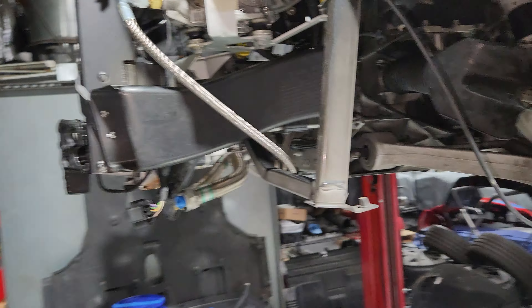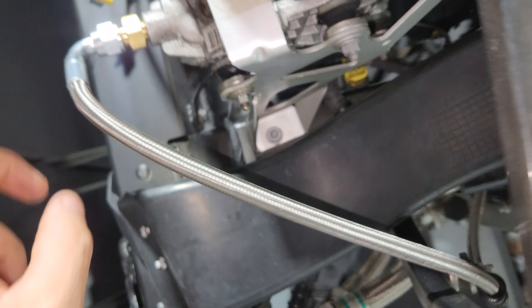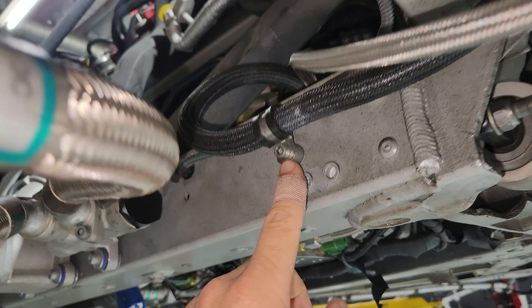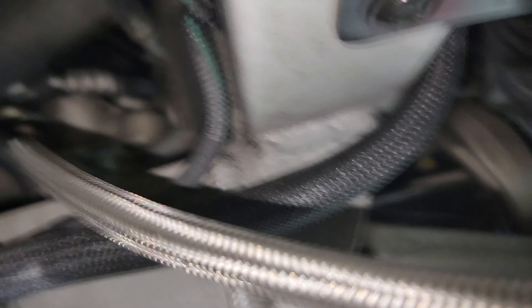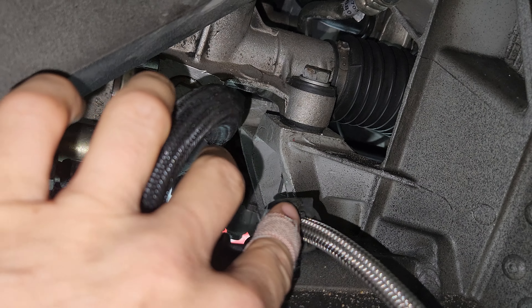I don't want it to get abrasion cuts on it. So how do I keep it like the factory had it? Well, you can just reuse the factory clamps. We run it here behind the bumper, just up here. This is where that radiator is — there's plenty of space here. We just go ahead and use the factory tie-downs for the return line here. It just stays in the factory clips going up to the reservoir there. And then the pressure line — we move the clamps to here, and then we use the same factory rubber dampening piece for this little part that goes over here. You need to put a zip tie on either side to keep that from walking.